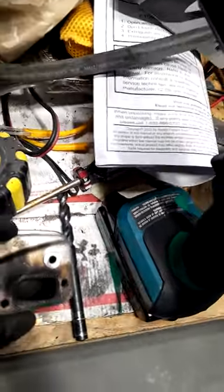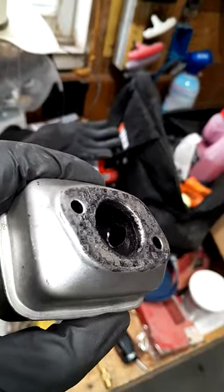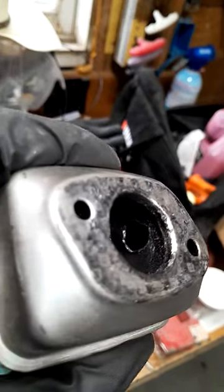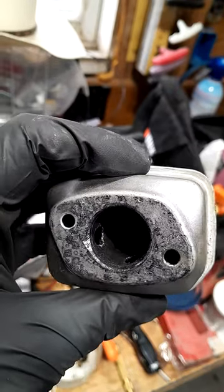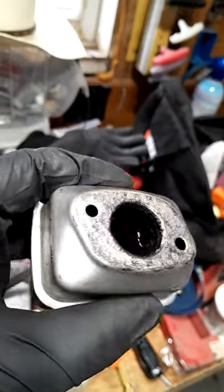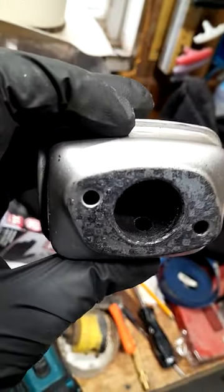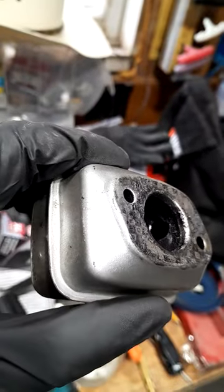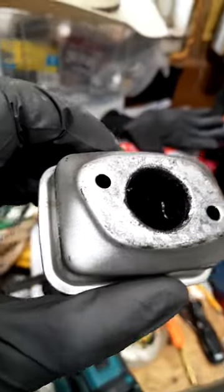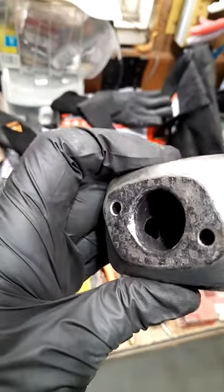As far as the muffler goes — I don't know if you can see in there — these side holes on the inside, I opened up to three-eighths: one there, one there, and the top one. The bottom one I opened up to a quarter, and then I just took a round file and cleaned up the edge, tried to get it to kind of flow as best as I could.